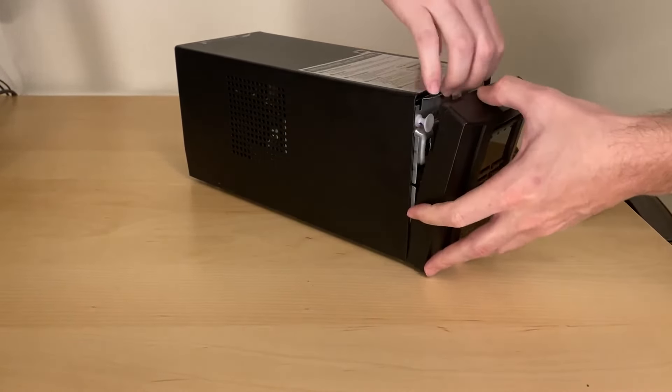To access the battery you have to remove the front panel. I used a screwdriver in the grooves on the side here to get it started, and then the front panel comes right off. It is still attached by a ribbon cable though, so you just have to kind of lay it on the top while you work on it. Then you can pull out on these two white pins here to lower the plate, and you should find the batteries behind it.